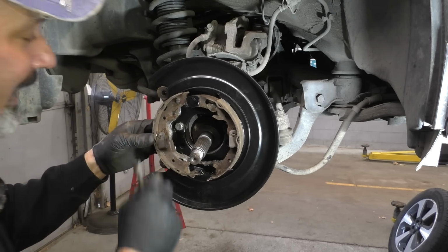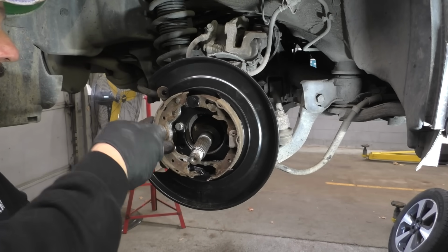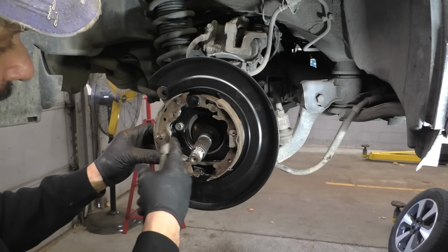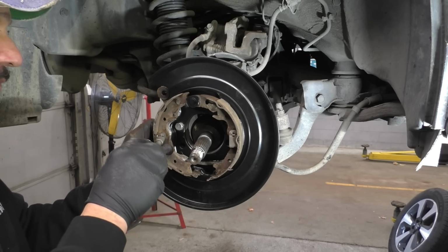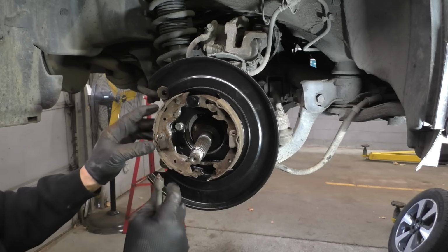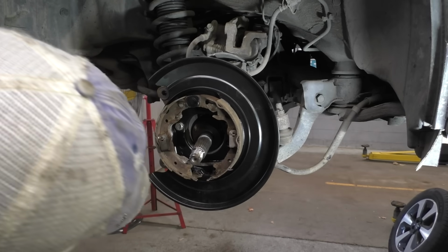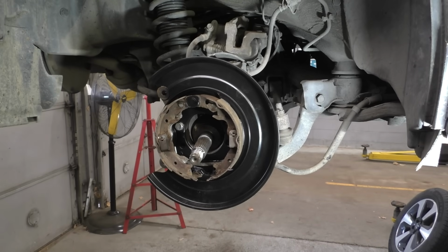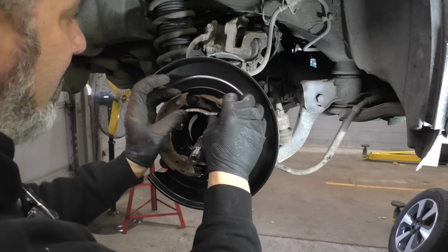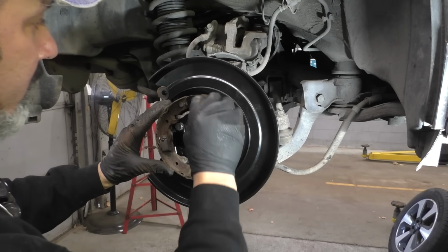This one's tricky because you have to get this one turned correctly. Nope, this one has to turn the other way. This one has the notch out of it to clear the park brake lever. So you have to make sure that you rotate it in the correct orientation so that the notch goes around your little park brake lever. Okay? We can still get our bolt out. So that's good. We'll put our little equalizer up here. Make sure everyone's equal, man.